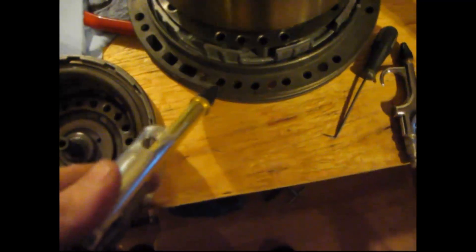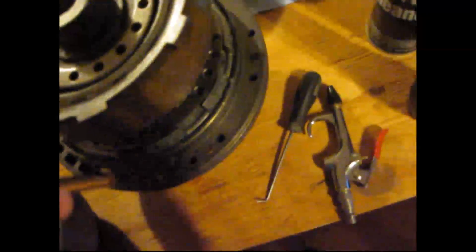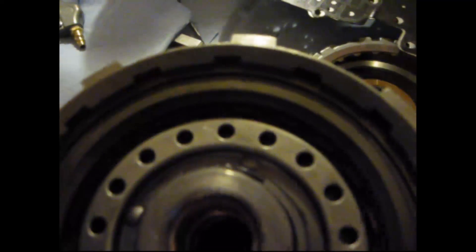I've got my air compressor on 25 psi, and I'm going to put a little air in this hole right here. You should see the clutch tightening up. What you're looking for is for it to compress. I'm going to check it a different way — I'll put my nozzle in this hole and then put my finger over this hole, and it should do the same test. I think that's going down slow enough to be okay.